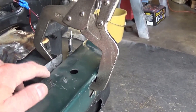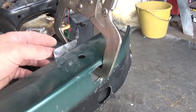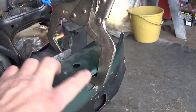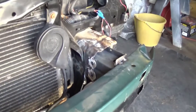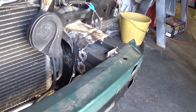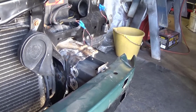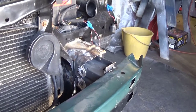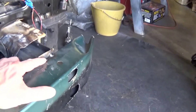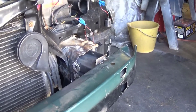Next I'm going to tack weld — just two small welds is all it's going to take. There's a bolt in this one here that bolts it in; the stud broke on the top side so I can't put a nut on it, but I can put a spot weld here and that'll hold it. Now I have those washers welded in place — I just spotted them in and then ground the surface off a little bit so they didn't have humps, because there's a bracket that supports the bumper that goes against that surface. Since the stud is broken on top, if it ever had to be taken off the welds could be cut fairly easily.